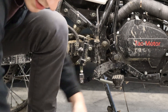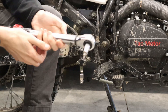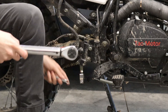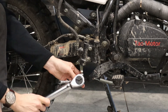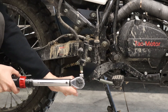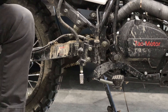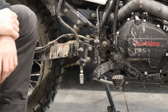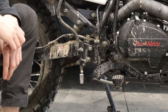Tighten the screw and nut until it locks onto the shoulder of the shoulder screw — you can feel it get pretty tight. Then switch to a torque wrench set to five Newton meters with a three millimeter hex socket, and use an eight millimeter wrench on the backside to hold the nut. Tighten until the torque wrench indicates you've hit five Newton meters. You should be able to feel a little bit of play between the clevis and the brake lever — that's designed in so it doesn't seize up and fits every TBR7 accounting for manufacturing variation in the brake levers.